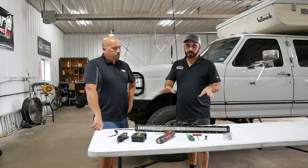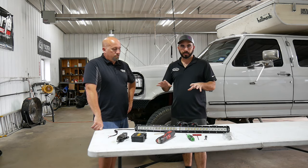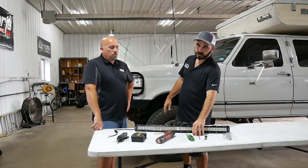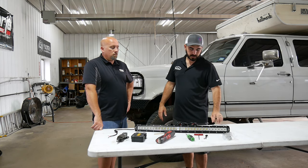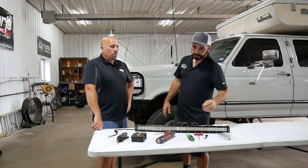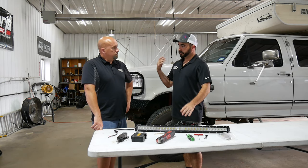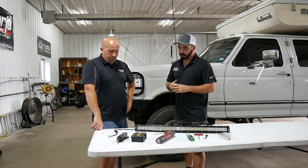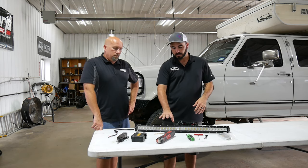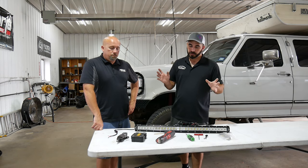We've laid out some of the basic tools you need. Some things may vary depending on your scenario, but you'll need a screwdriver for the grill, a 5/32nds Allen wrench, a 7/16th wrench for the hood latch relocation bracket and bumper brackets, a right angle drill for drilling the header panel, various drill bits, and a cutoff wheel.